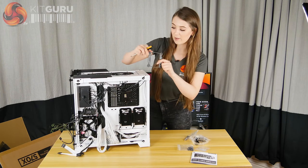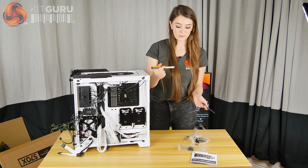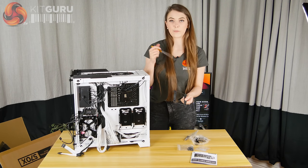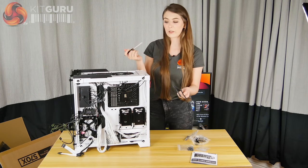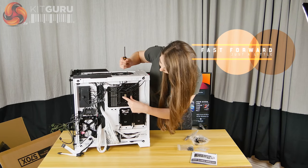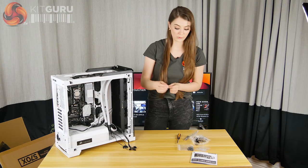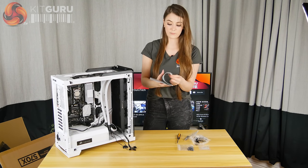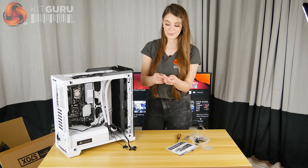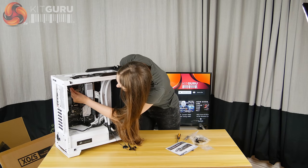But yeah, so let's get the bracket on at the back of the motherboard. I've read through the instructions a little bit, because obviously every all-in-one cooler is a little bit different. I've got the mounting bracket set up for the socket that I'm using, the 1151 socket. And then I've got the standoffs to screw in. I'm just going to make sure that I'm screwing them in the right direction. I think they go from the front, yeah. It wouldn't make much sense if they went in from the back, but I will check to make sure. I didn't want to mess up.